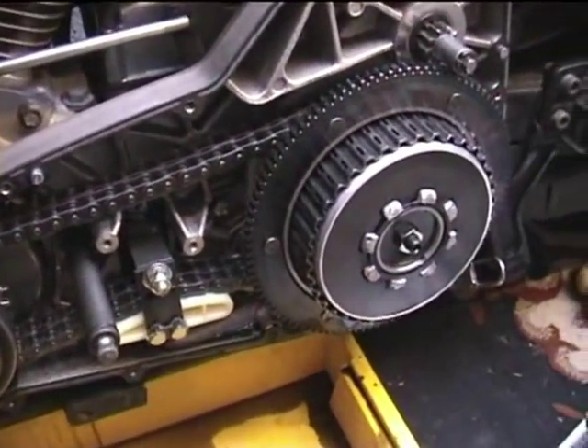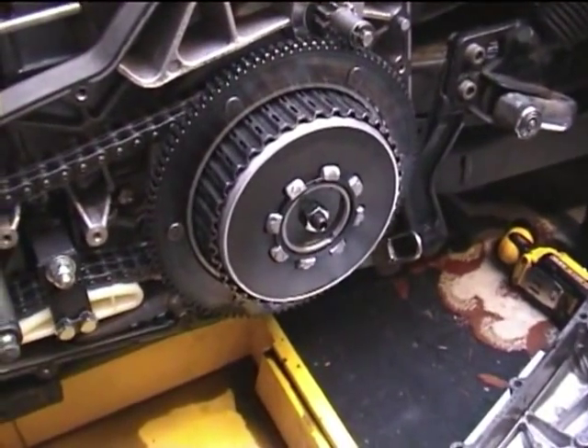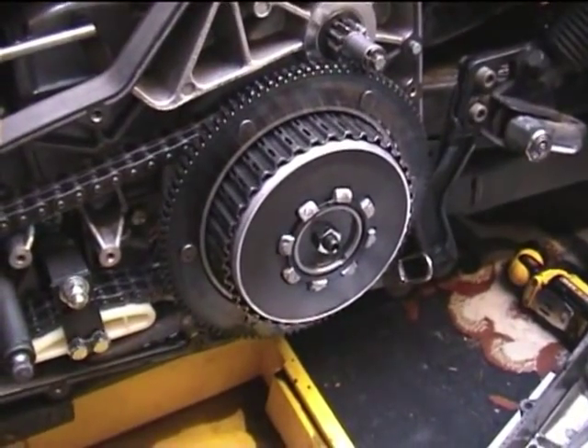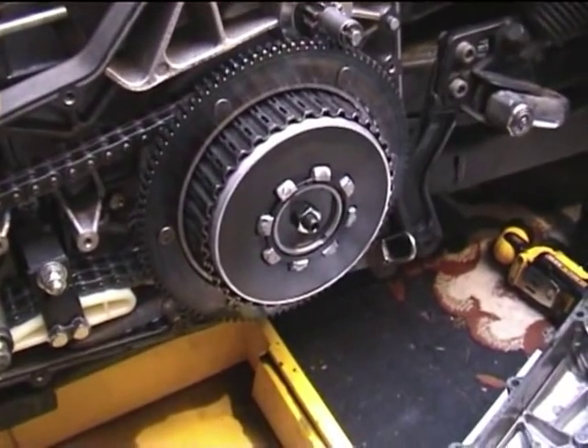If you drain the oil first — there's a little drain plug that sits right behind the clutch basket on the primary chain case cover — you save yourself a fairly serious load of oil spillage when you pull this away. It's probably pretty obvious but I also tend to mark the length of the screws, draw things down, photograph things with my mobile phone, and then bag things up — it's a really good idea. So those are long and short screws at the positions on the primary chain case.